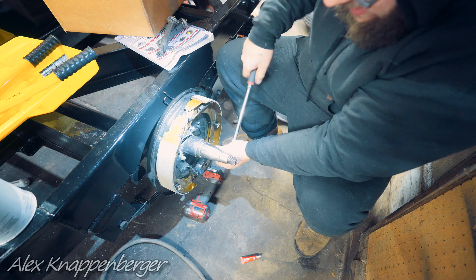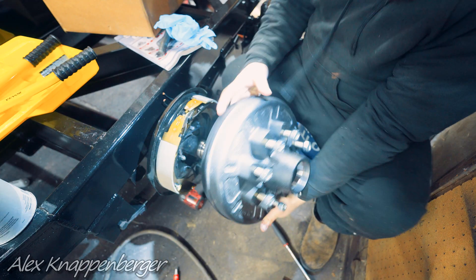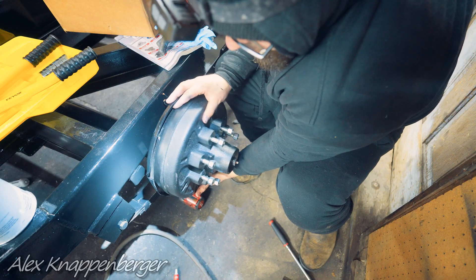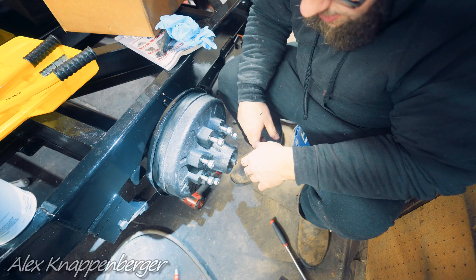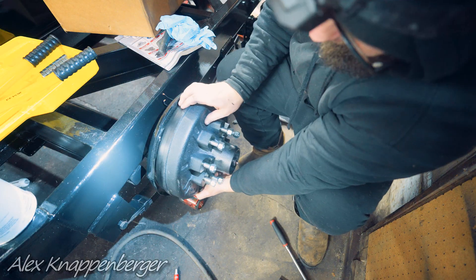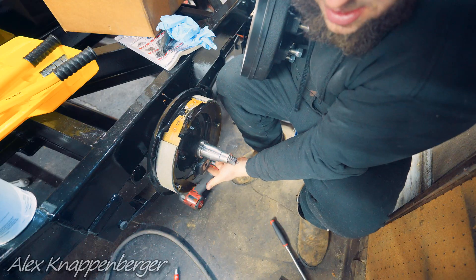The impact does the trick but I just want to check them by hand too. Before going any further, take your brake drum and try to slide it over the shoes to make sure it goes on — because sometimes from shipping they might not be set right. The shoes can open up and the adjuster will be too big to actually get the drum on. So double-check that before you go further, because you might have to adjust the adjuster down here.